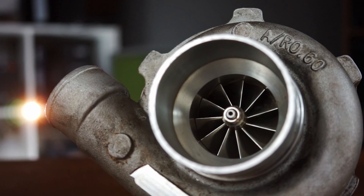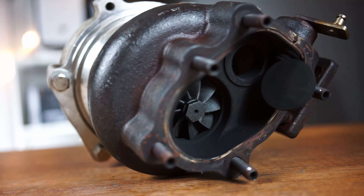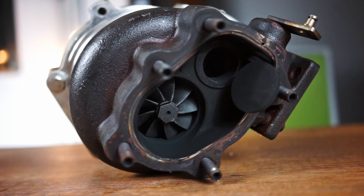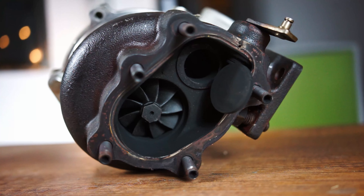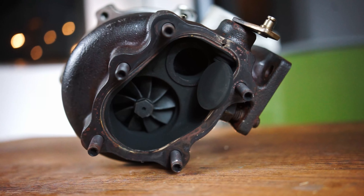You don't really always need a ball bearing turbo — it's application specific and will only benefit you in some cases. It's not a must if you don't have the budget or want to spend it elsewhere, for example in the manifold department. But it can be a nice to have, especially if you're looking for more transient response after shifting.